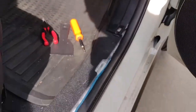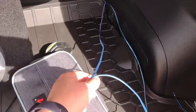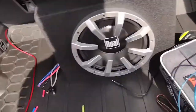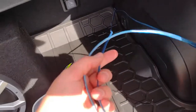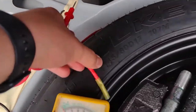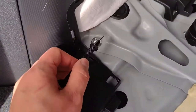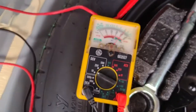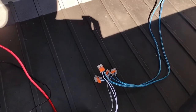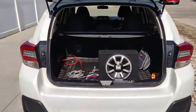Make sure you run your speaker wire down a different side of the car than the power wire — this will help ensure a clean sound when everything is running. With the speaker wire ran along the passenger side and the power cable ran alongside the driver side, the last thing I need to do is find a strong location to ground to. Found one! Using the multimeter, I connected the positive and potential ground to see what voltage would run through it. With everything in place, we can now connect the speaker wires to the LOC and hook the amp up. I'll be cleaning these cables up a bit later, but for now, thanks for watching.